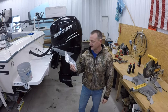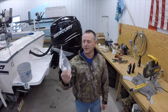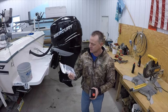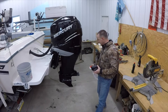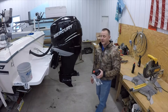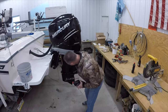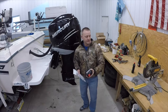The last thing I'm gonna do for the service on the motor is the gear oil. I bought one of these gear oil pumps to go with the bottles. The whole thing is we're gonna pump in from the bottom drain hole and fill it up until it comes out the top fill hole. We want to make sure we're at a good vertical and horizontal on the lower unit so that we're getting a good, accurate fill level, and then start pumping some lube into this thing.